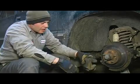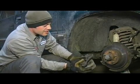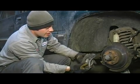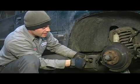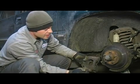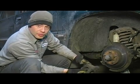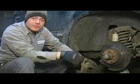Just like so. If you're having difficulty sliding your caliper off the ridge, it may be necessary to compress it. What I mean by compressing it is to slip a screwdriver in between the pad and the caliper piston and lightly compress it backwards. You only need to compress it very slightly to release the static tension the pads hold on the rotor. That is the proper service procedure for removing your brake caliper.